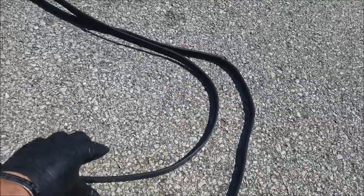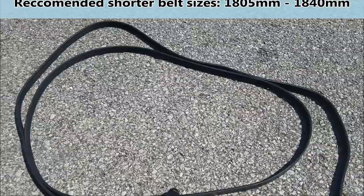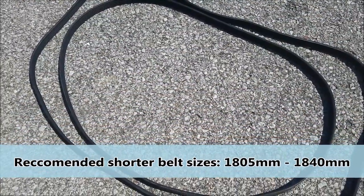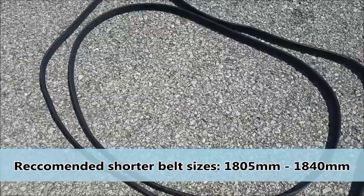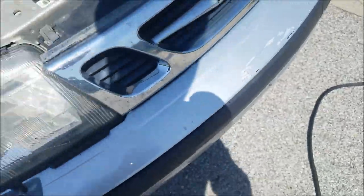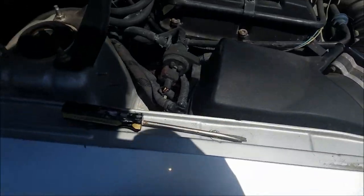Here's the long belt, and the short belt is much shorter. What this will allow you to do is, in a pinch, bypass the AC compressor and continue to drive the car until you can get it fixed. It's great for if you're ever on the road and feeling like you might be stranded — and you will be, unless you have a short belt in the trunk.